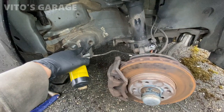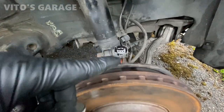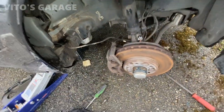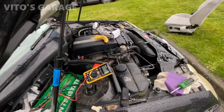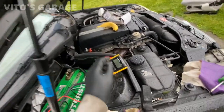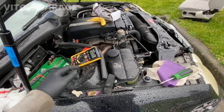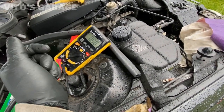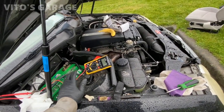I don't know if we're getting a new siren or a good used one. I just put liquid electrical tape on this connector so water doesn't get in while it's disconnected — not worried about the siren side. What's really funny is I disconnected the mirror on that side and the draw was still at 0.11. Then I reconnected it and some moments later I see the reading is the same — the mirror is connected right now. That's really strange. I'm going to monitor this again; maybe some other system went to sleep.